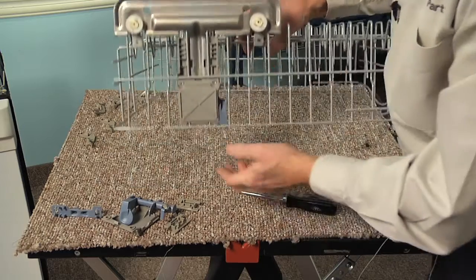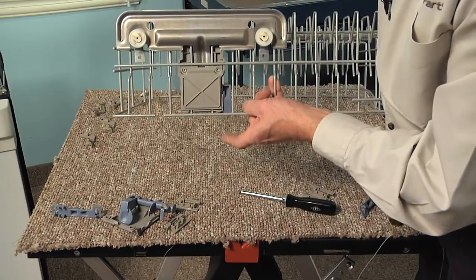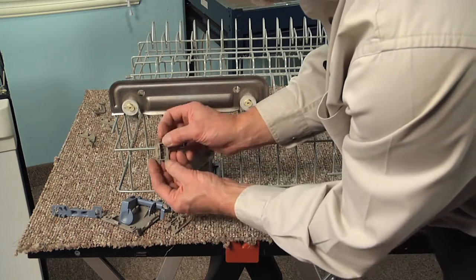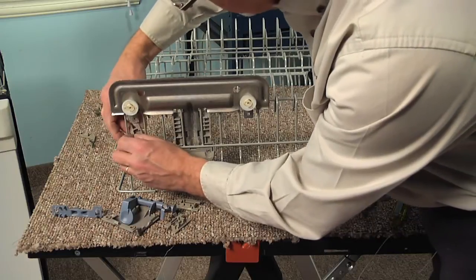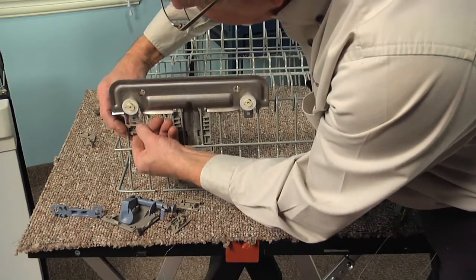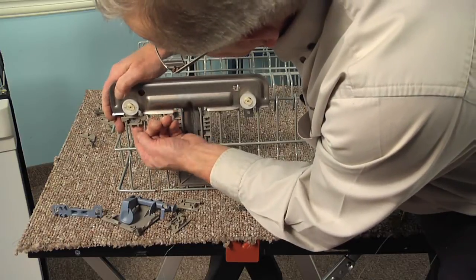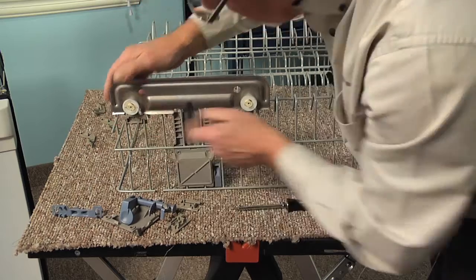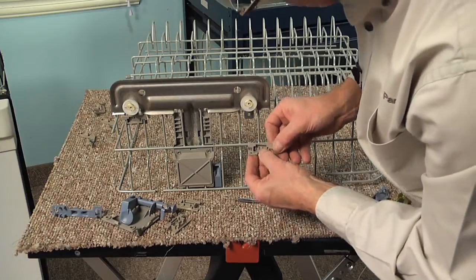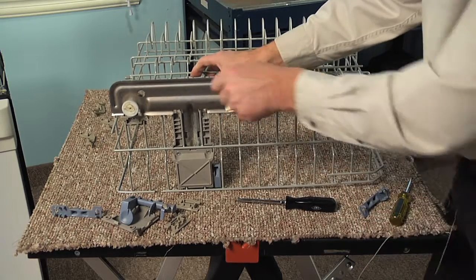Now, with those two screws in position, you just check the operation of that by depressing the cam button. Next, we'll put those plastic position guides in place. So just sit them into the opening, rotate them so that the tabs fit on inside and outside of that vertical wire. Slide it up onto that metal tab on the adjusting bracket until the little locking tab engages. The same for the opposite side. And then repeat for the other adjuster.